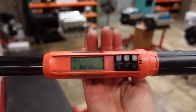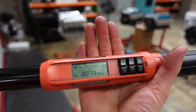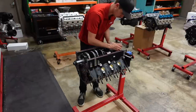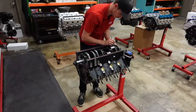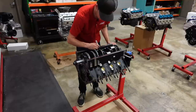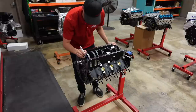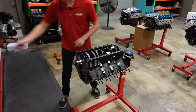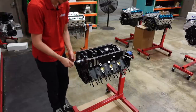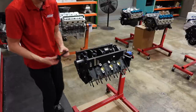I really like these Snap-on wrenches because they actually count for you, so if you're questioning whether you did all 20 bolts, you've got a little counter. Now that everything is torqued, we want to come back and put a little paint mark on our fasteners so that anyone who comes to the motor next knows that all these are torqued and final installed. Let's see how the crank feels — oh yeah, super smooth, no hiccups. Next we're going to check thrust clearance, which is the crankshaft's backward and forward clearance in the block.